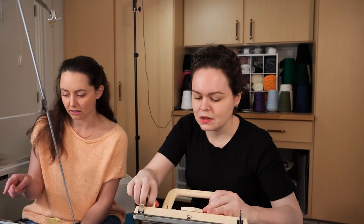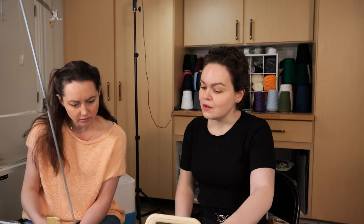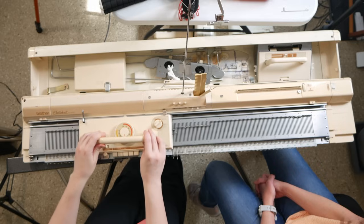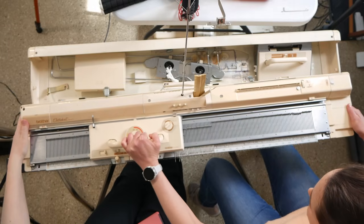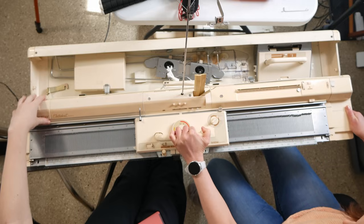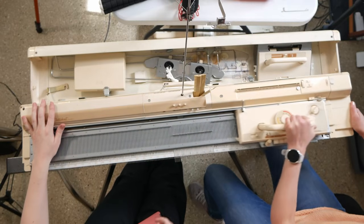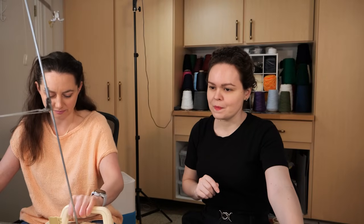And so normally if you had the electronics, it would be coming through on here to tell it? No. The way the Brother machines work is there's a mechanism underneath the bed. The timing belt is only used to tell where the carriage is. We hook into it, and it gets a little stiffer to move. That's hooked into the belt on the back, and that's turning these things in here that tell us where it is. It doesn't go back the other way when it's in the middle of a row. So you've got to get to the end, and then you can go back. You've got to get to the end of the needles. You don't have to go all the way. Oh, okay. Got it.